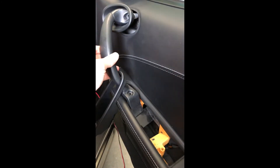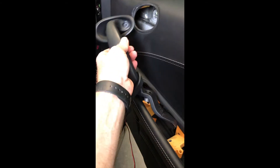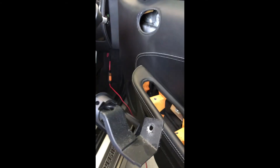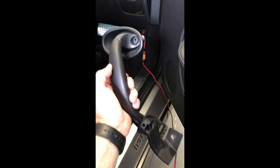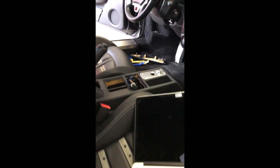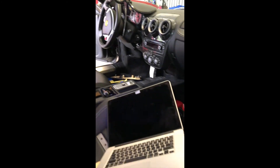This is a little tricky to get out because of the way the bracket is. With the screw undone and everything else undone, what you do is pull this out and rotate, and then the assembly comes out. Getting it back in is just the same way in reverse. There you go — door handles removed, door levers removed, everything is ready for shipping to be refinished.